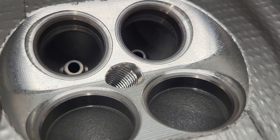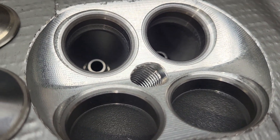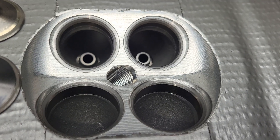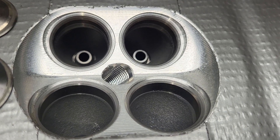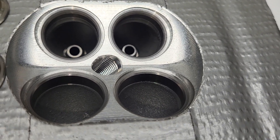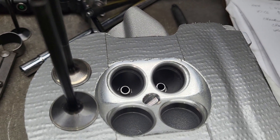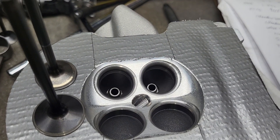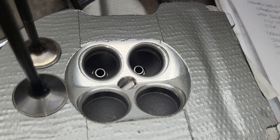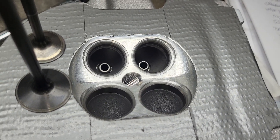Now these are so small I cannot measure the concentricity on here — I don't have any guides that are that tiny. Some of the issues flowing this are multiple. One, I don't have a bore anywhere near that size, but it is almost exactly the same size as my 500 CFM calibration plate. I also don't have any small springs to put the locks and retainers on and compress them. So I may have to do some real hack work in order to at least get a baseline of what they flow as they are, and then do my work and see if there's a difference. It's going to be kind of ugly.